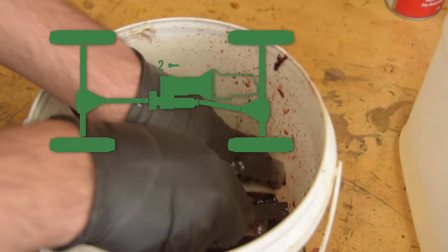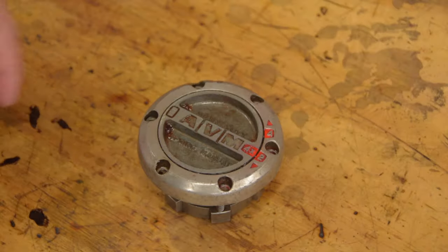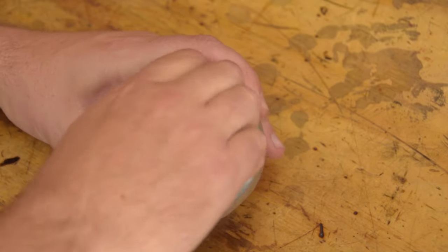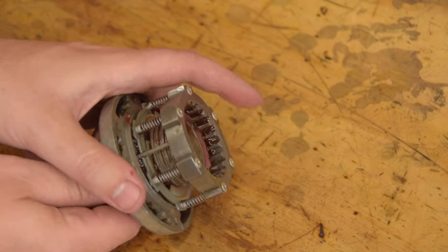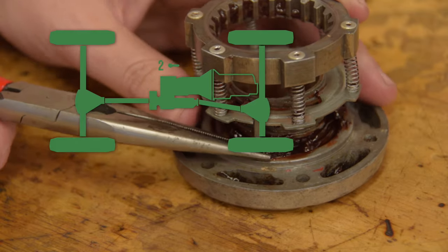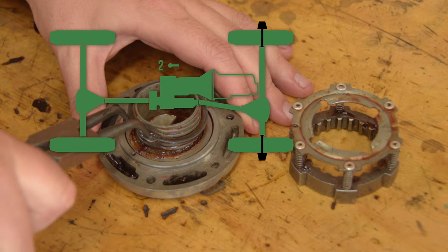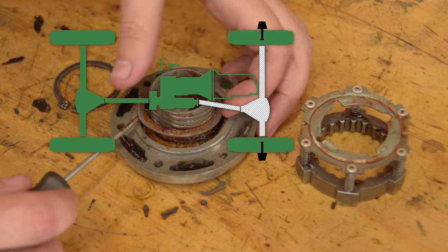There's quite a bit of mechanical friction involved in turning half of the driveline for nothing, and wear and tear that goes with it. So freewheeling hubs are a lock between the front wheels and the front axle. When they are locked, the vehicle is exactly the same as a vehicle without freewheeling hubs. When they are unlocked, the front wheels are disconnected, meaning they roll along the road but are not pushing the front driveline along with them.